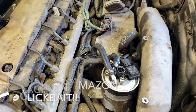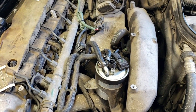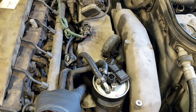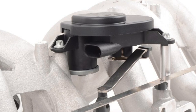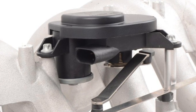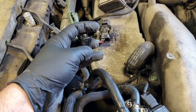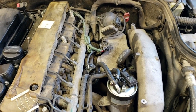You need to get to the M55 inlet motor connector - you can pop it out with a screwdriver. You can't see this motor; it is buried in the Bermuda Triangle depths of this engine, but it looks like this, and I believe you remove it from the bottom if you wanted to replace it. I don't recommend replacing it - if you can get away with this hack, definitely do it. I'll list all the trouble codes that may apply in the description box. To do the hack, take your resistor, bridge the middle pin and the pin closest to the flat side of the connector, wrap it in tape, zip tie it away, put your engine covers back on, and that's it. Clear the code and you should have all of your boost pressure back.